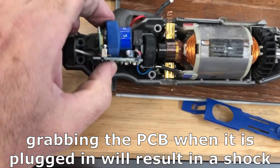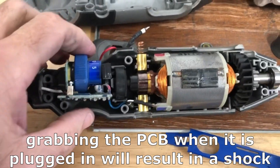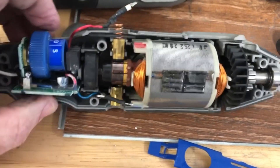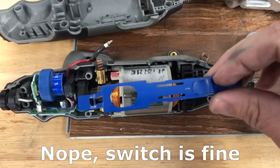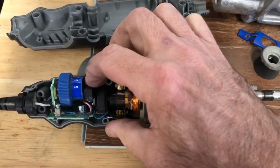This printed circuit board just has a slot it goes in, and you can pull it out. The switch right there is actually what turns it on and off. You may wonder why the switch is way back there — when you push the slider up, that little tail on the left-hand side of the blue plastic pushes that switch down in the back. It's kind of an outrageous design. See if you can hear it clicking.